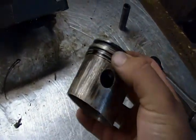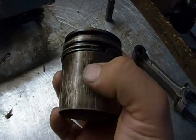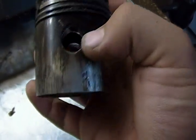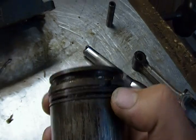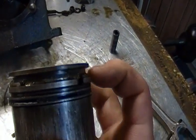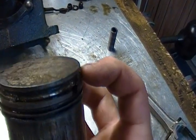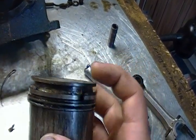As far as the piston goes, the piston is very rough. Lots of small scores — it's nothing too serious, but certainly well worn. I've got quite a serious problem here: the casting between the first and second compression ring is broken away. I guess it's about an inch and a half long spot there.